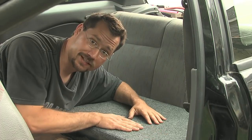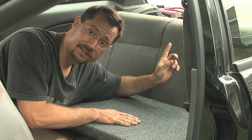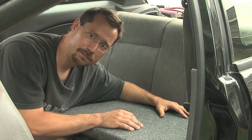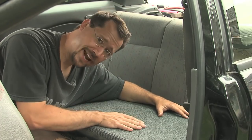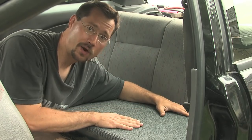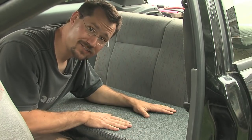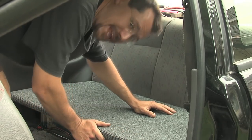This is my back seat — well, it formerly was. Now it's actually the battery box and the battery box protective cover. I still have the original seat back here, which is mostly just used to divide the passenger from the cargo compartment. This folds and it's removable so if I want to use this whole area for cargo I can still do that. I also removed the back seat seat belts — the way the battery box ended up, the seat belts just didn't work real well. The cover itself is just a piece of three-quarter inch plywood cut to size and wrapped with some very inexpensive 100% recycled car carpeting.